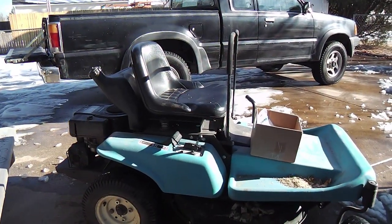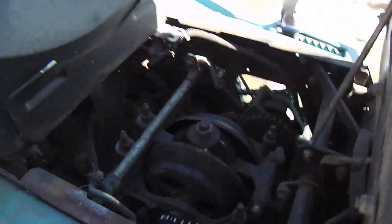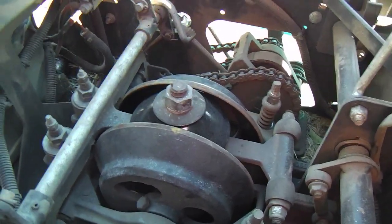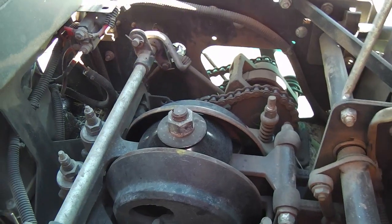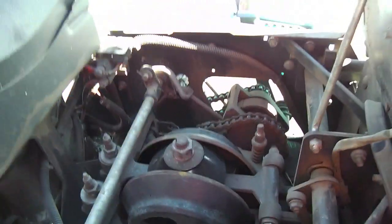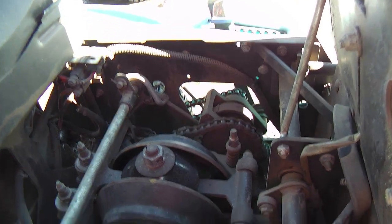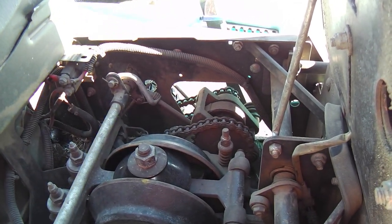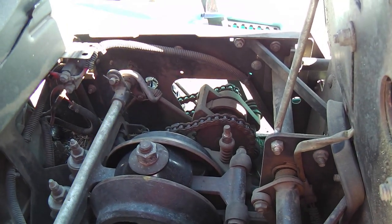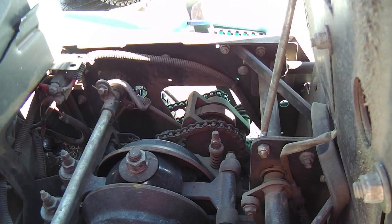Dig how this still has the older friction drive. There it is, if you can see the shot here. But there's two cones and two cups, and when you move these levers, it not only drives the system forward, the rear wheels, but it actually turns depending on how you're moving the two levers on each side. So you push both levers forward and you go forward, you pull them back and you go back. You leave them just dead center in neutral and you come to a stop.